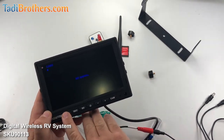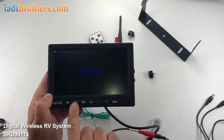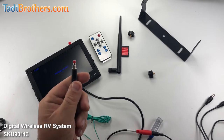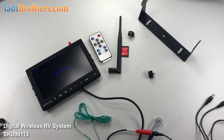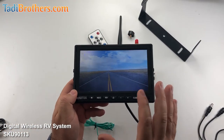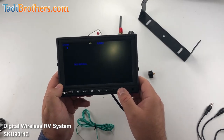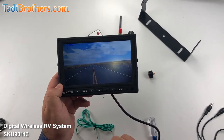Right away it's already paired. When you get it out of the box, most times it's already paired for you, but I'm going to show you how to pair it just in case. So what I'm going to do is move to channel number two, because that's the one I want to pair it to. I'm going to click on menu and record — which is the enter button — and the pairing process begins. You see a countdown here with the numbers. Then I'm going to push on this button right there, and then the pairing will stop after a couple of seconds. Now you see no signal, and it pairs. Sometimes it might even take you an extra couple of seconds showing no signal, because it's negotiating the settings. The camera I just set up is no longer on camera number one — it's now moved over to camera number two.